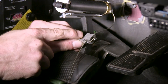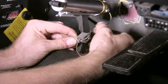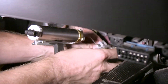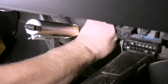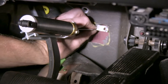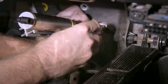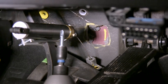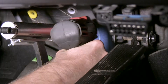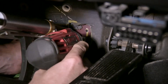Now we'll work with our cable clamp. We need to shorten our cable where it takes up just enough slack, and anything after that we can adjust with our air cylinder. Basically we have it going through the set screw a couple of times. We wrapped it around twice and pushed it up to the firewall to get a good idea of our length, then tighten it down. Let's attach it to the wall - hold the bracket up, make a mark, and drill the hole. This fastener comes with the kit and uses a 3/8ths nut driver. It's a good idea to check the other side to make sure it's not going to hit anything. Once you're satisfied with the placement, put it in for good.